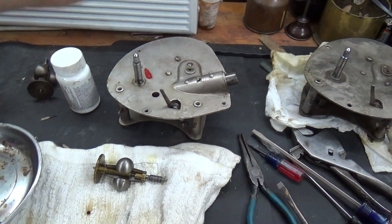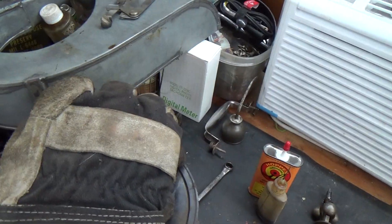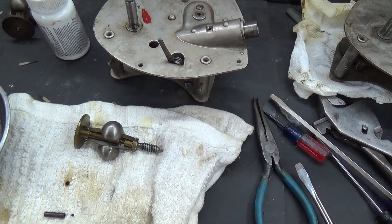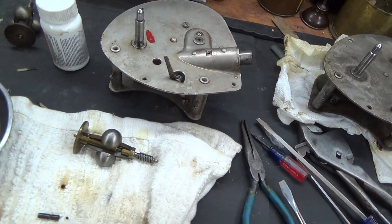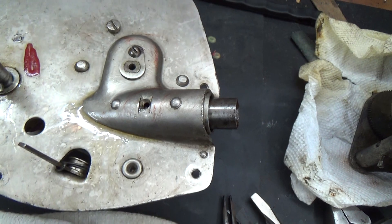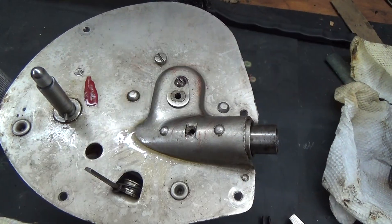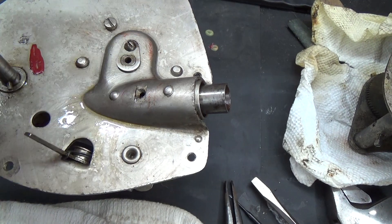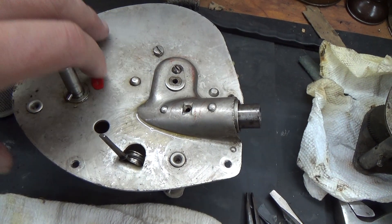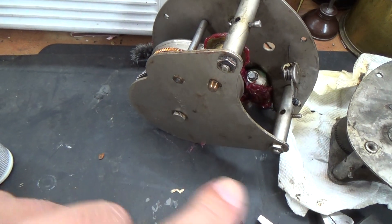With the 101, it's four screws, take the turntable off, remove the auto brake if you have one, and the motor board lifts right out — maybe 20 minutes. With the 102, you have to take the entire board out: a lot of screws, a clamp, everything. Then the motor is inset around the horn, so you either remove the horn assembly with two screws or drop the motor out with four screws and spacers. Once you're in, you can see the shaft and oil holes — but those only lubricate certain areas. There's a bearing down here that needs lubrication and oil simply won't penetrate all the way down there.